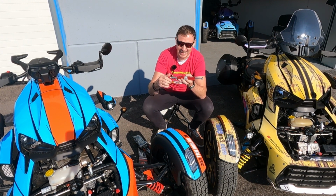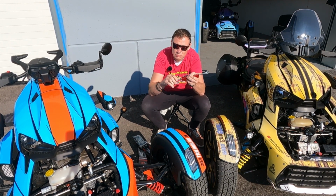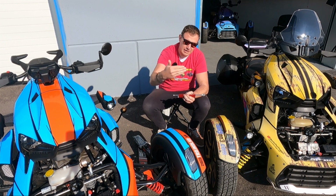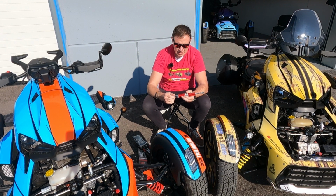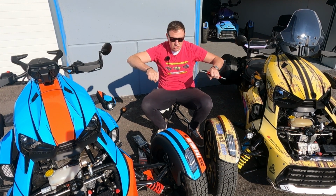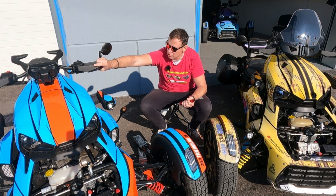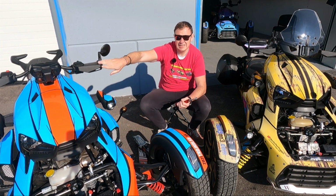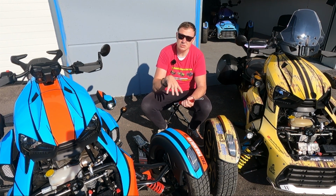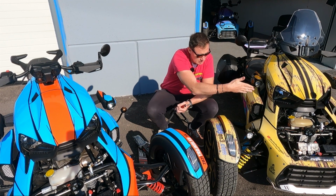Have you been listening to how this thing works? You need to use some force, some pressure, in order to move this around. And that's where my story about it not being for everyone comes in. In order to move that damper that eliminates the shakiness, that eliminates the wobbling, you need to use extra force to move your handlebars around. That is the reason why, from the beginning, I will use it only on two bikes: on LeMans, where I will use the sport version of YSS, and on Dakar, where I will use the stock version of YSS.